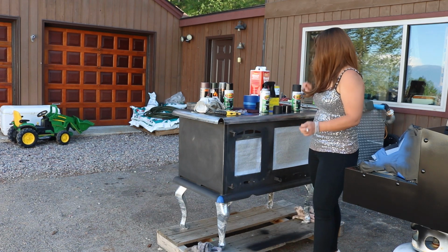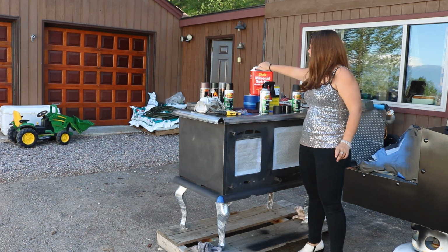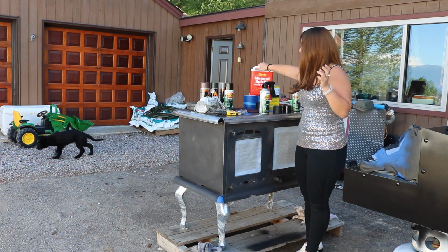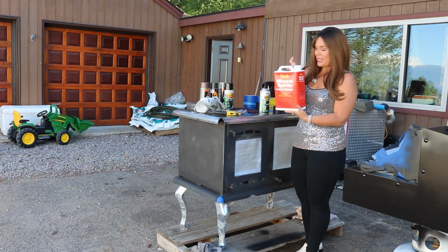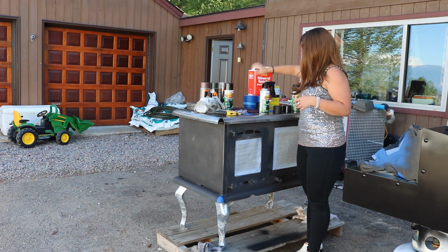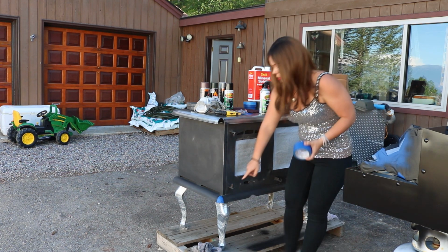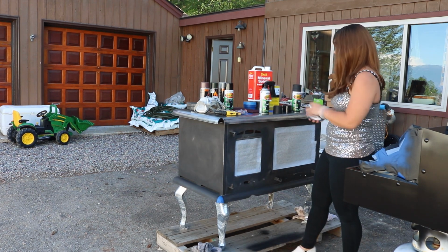A few other products that you're going to want when going through this: anytime you're painting, the stove needs to be really cleaned off. So we recommend the Mineral Spirits paint thinner to wipe the stove off with prior to painting. And of course, taping it off is super important, because for example, there are certain chrome corners down here. You don't want to have a mess, so really be sure about that.